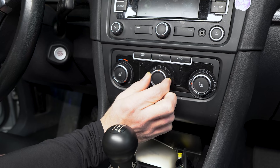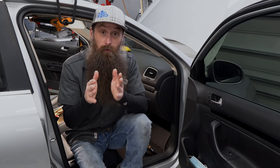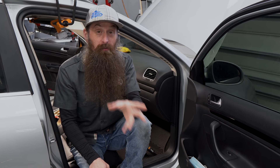After some quick poking around, found that the noise was directly related to the speed of the blower motor. So odds are we have a blower motor that's failing. In this video we're going to be replacing the blower motor and doing some inspections to make sure we don't just have some junk shoved up in the blade. This is not the only way a blower motor can fail, so after we replace it we'll talk about some other things you might want to look for if you're having blower motor issues.